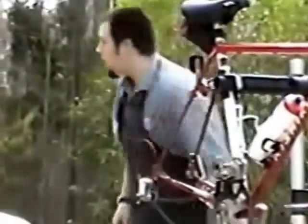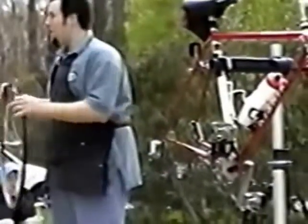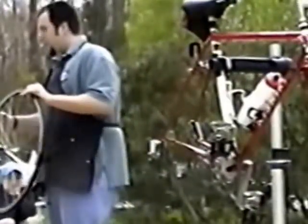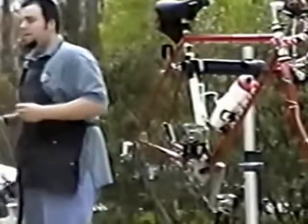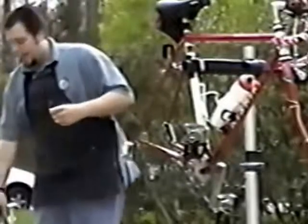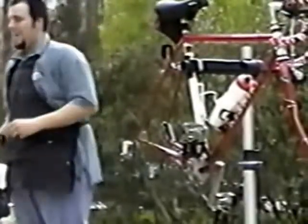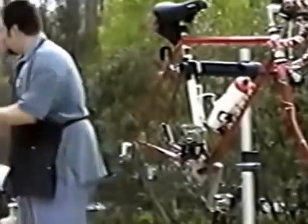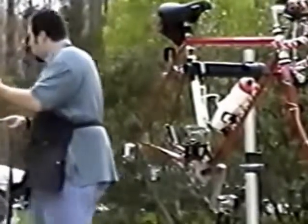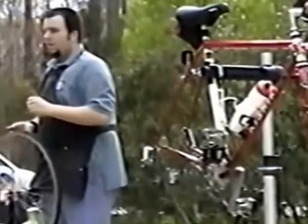If you really want to be safe, but then also what you want to do is try to find the cause of that flat. You do that, unfortunately, with the tire off the bike. Say you get a flat, and when the tube is out of the tire, pump it up, and you can pump up tubes huge, and they'll get this big. When you pump up the tube when it's not installed in the tire, it'll exaggerate the holes that are in the tube, and you'll be able to hear the air rushing out, and you can find out what caused that hole.